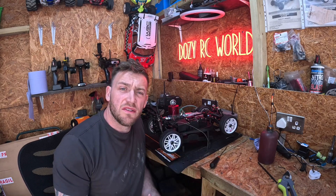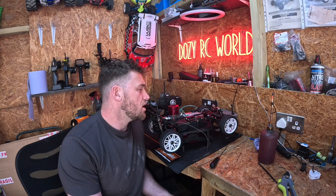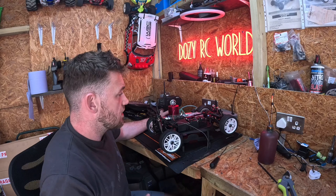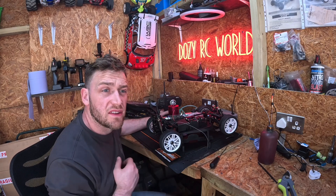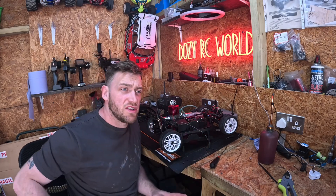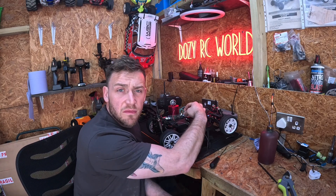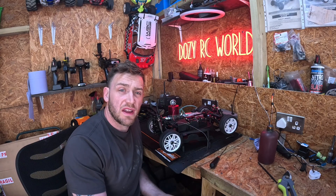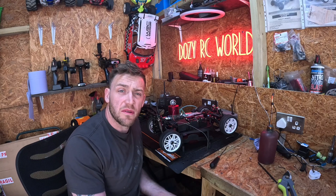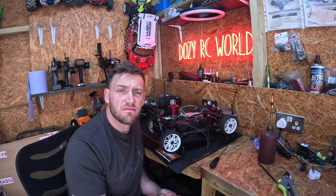That's just a quick guide on tuning your low-speed needle. Any questions, put them in the comments below and I'll get back to you as soon as possible. It's idling nicely now — it sounds good, and when you do the pinch test the RPMs rise because you're starving the engine of fuel, then it shuts off at four seconds dead on. Check my other videos on tuning as I've got more in-depth content there. Thanks for watching guys, cheers.